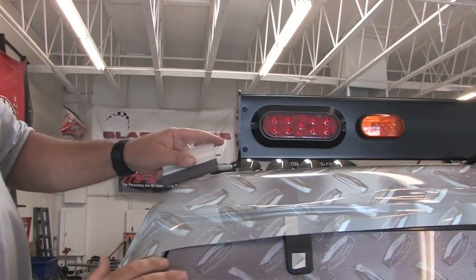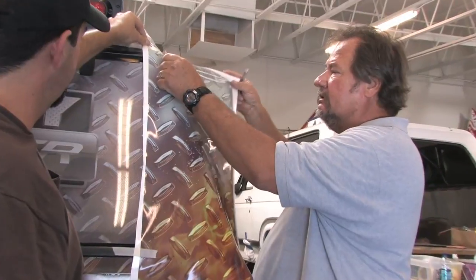The design fit the vehicle well. It's done with the two-way vision window perf on the windows in the front and the sides. The rest of the vinyl is done with an air release with a 4 mil clear laminate. Anyway, you see the product here, you can transform a basically stock-looking vehicle into a wild custom, and it only takes about a day and a half.